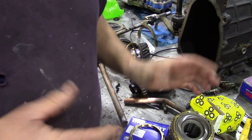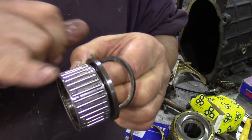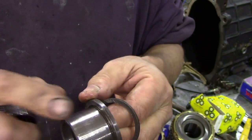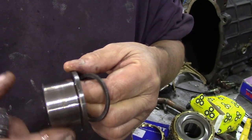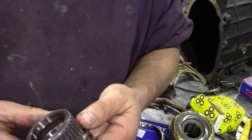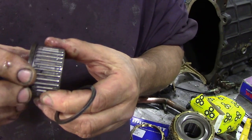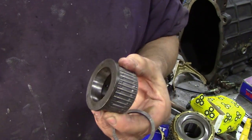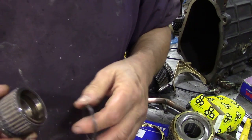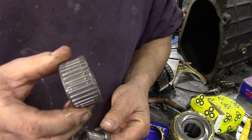Bearings and things like that - it's kind of self-explanatory. What you want to look at on a bearing is: are the needle rollers all complete? Are they broken? What is the sleeve like - has it worn a groove inside? Generally speaking they're alright. When you put them together inside the bearing, rattle it around and generally speaking they're always okay. We replace them anyway because we can - while you're in there you might as well. Generally very, very little trouble from the needle rollers.